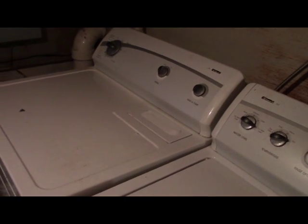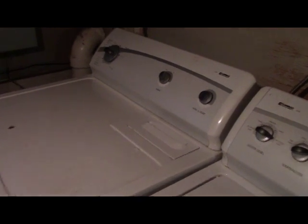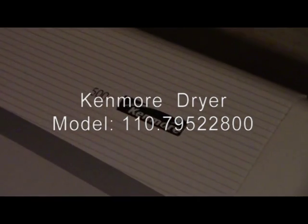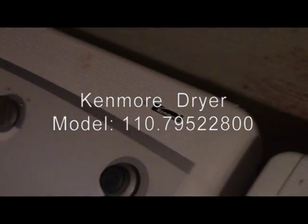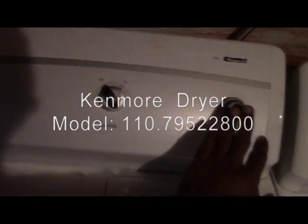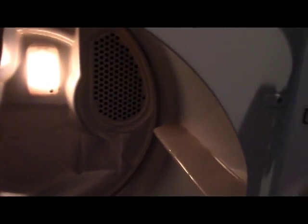We got this Kenmore gas dryer. I want to replace the igniter in here, the burner igniter. Basically, when you cut it on, you don't get any hot air at all. The air just blows, but it doesn't heat up at all.